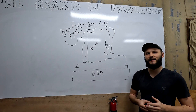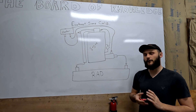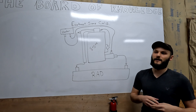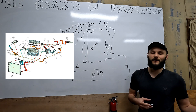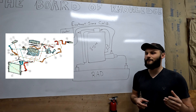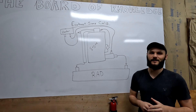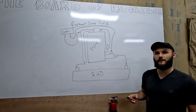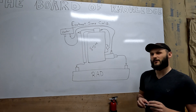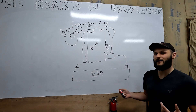This is what I came up with — a simplified version I made from the Focus ST coolant diagram. It's pretty complicated on the Focus ST. There are coolant reservoirs and T's in some of the lines, some small plastic tubes that run all over the place. This is what I came up with though — it's quite a bit easier for the swap cars. This is also a little bit Mustang specific because of the radiator.